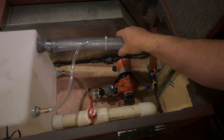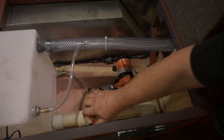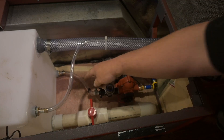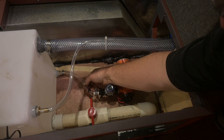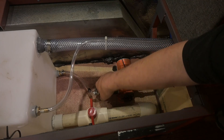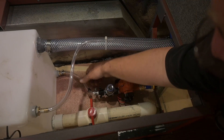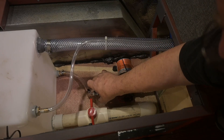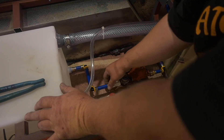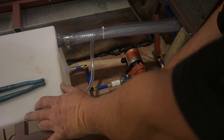This is what we've got so far: fill hose, vent hose, and drain pipe here. There's our drain going down under the camper, and this is our inlet. I don't like this at all — I didn't have the PEX fittings I needed so I got something at the hardware store. On the inlet side it would probably suck the fitting in even more, so we're going to switch to PEX here. Half-inch PEX going into a half-inch coupling onto the strainer, through the pump, out with half-inch PEX. I'm a lot happier with that.